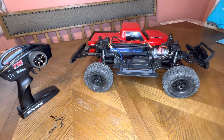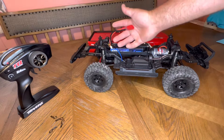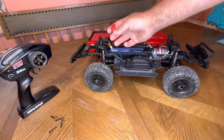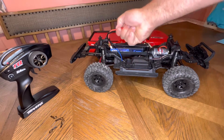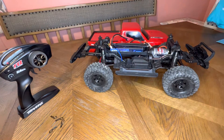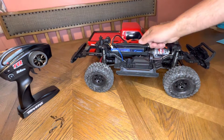You are going to have to provide your own battery and charger. In my case I also provided an adapter — I don't have a problem with Traxxas batteries, but you can't use them for other stuff unless you have another adapter. A seven-dollar adapter from the hobby shop or Amazon works well. Just be aware: if you cut and change the connector, you're going to void your warranty. If your electronics or motor fail, they will know you cut it — no matter how good you are at soldering it back.